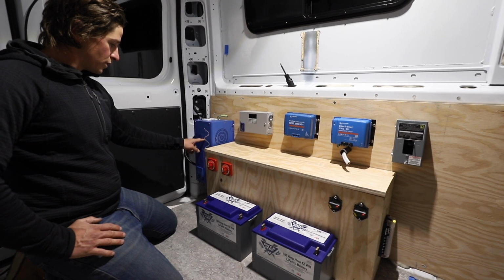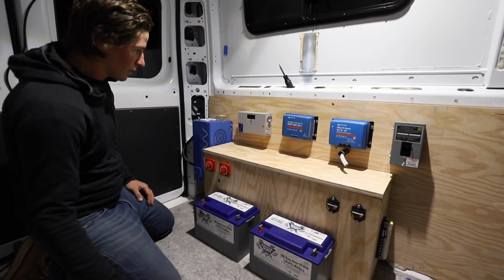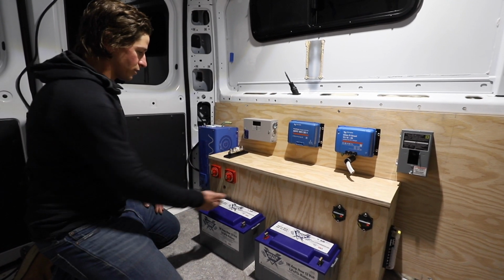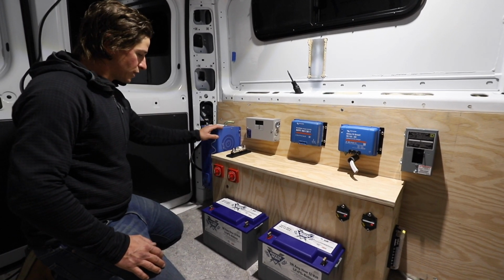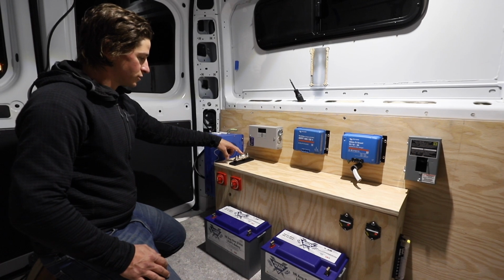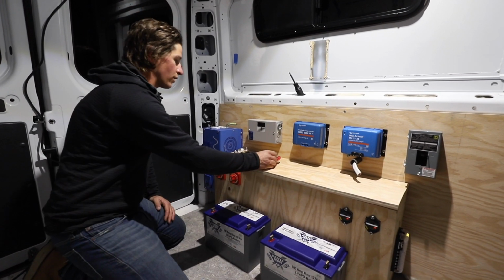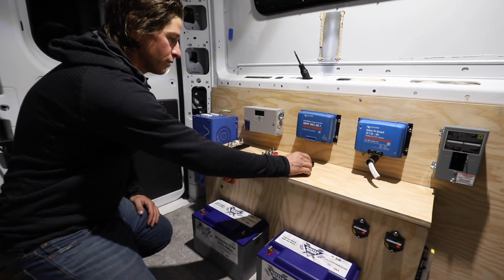This is a switch for the inverter charger, and this is a switch for the batteries, and they're both going to be tied in to a Class T fuse, which has yet to be mounted, but it's going to have some wiring inside and coming out the top here. So the inverter and the batteries will both share this fuse, and then it'll go out to our distribution for DC power. So that'll be the positive bus bar there and negative.